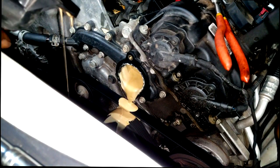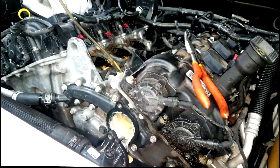So that's why when you get a first sign of your oil filter adapter housing leaking, you should go ahead and replace it right away before this happens. Okay, that is a warning. If it's leaking, replace it. Do not try to repair it. It was built poor quality.